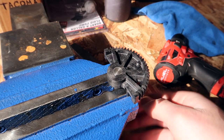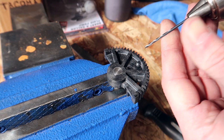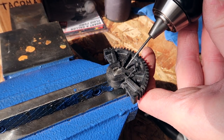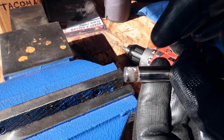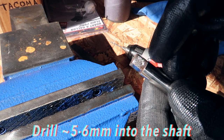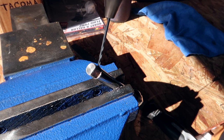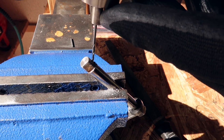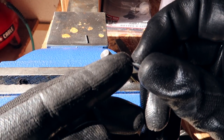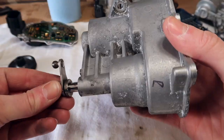Take your gear with the shaft still attached. Take that same three millimeter drill bit that Odometer Gears provided and drill through this little nub at about a 45 degree angle straight through until you're about a few millimeters into the actual shaft. We removed the gear and you can see where we drilled a little bit into the shaft. We're going to drill about five or six millimeters into the actual shaft so we can gauge the angle. Note: the drill bit did break inside, but that's about how deep we got — go get another three mil bit and continue on the next one.